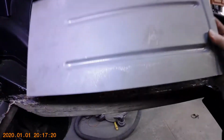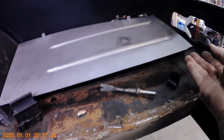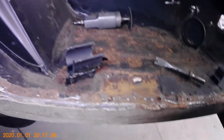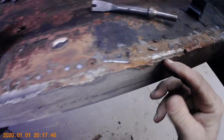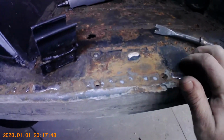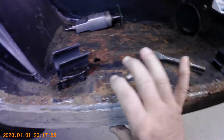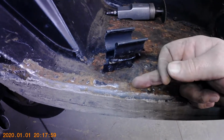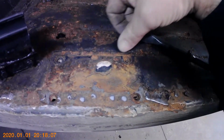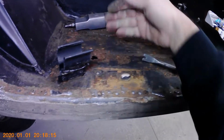And as I'm finding out, when I pulled out my trunk side pieces to lay them in, and this is the right side panel here, I noticed that it doesn't come over to meet the center pan. So on closer inspection of the rails, it looks like the frame rails in the back are solid, because this corner is rolled. It's not got a piece that's laid on top of it. So the frame rails are not solid, but it's a tubular piece. And then the center floor pan lays into about here. And then this right side pan comes into here, as I can just about see where the two pieces come together. Right along here is where this other pan comes in. So there's a lip over here that pan will sit onto.